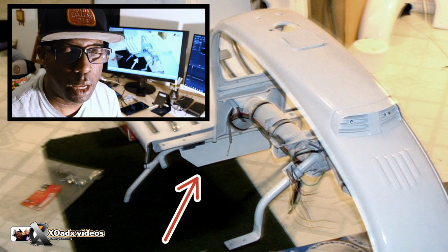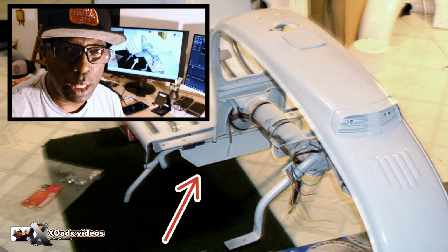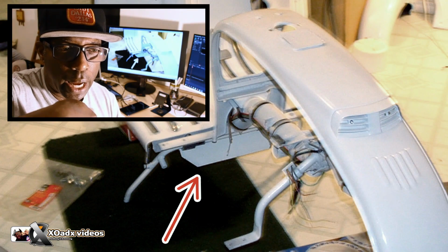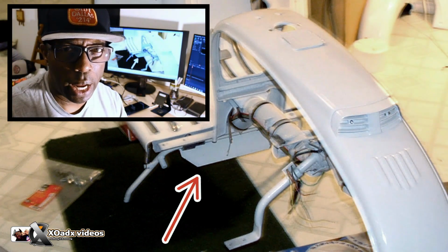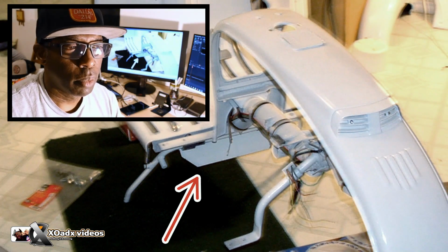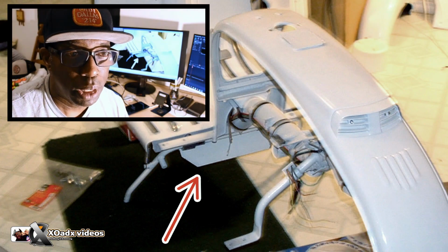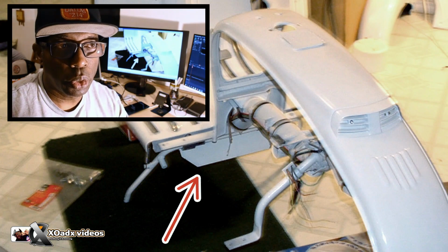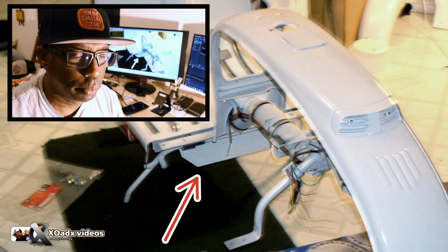Now, these are modern times, and most of us are riding our Lambrettas on the street. Take that thing off. All 3 of my Lambrettas, I had that part break off. It hangs down, the bike is vibrating, and that thing under the bike is just waving like this. It'll cause a stress crack and cause those to break off. Either it broke completely off, or you hear a rattle and you find that one side of it has broken off.